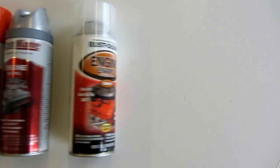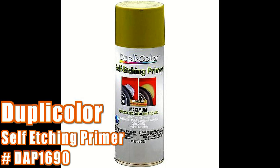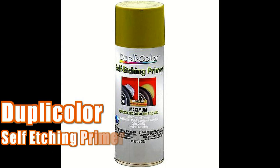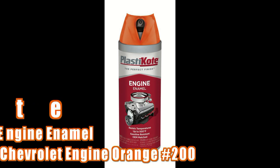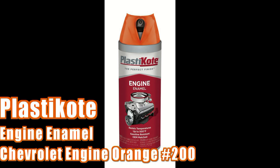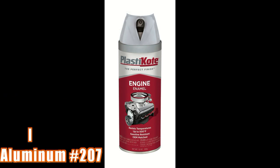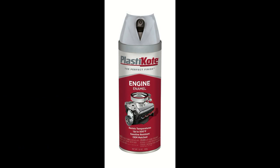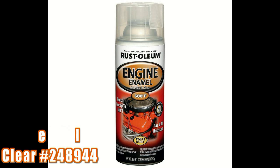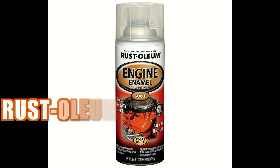Here's the lineup of paints. For the primer base coat on all plastic parts, I'm using Duplicolor self-etching primer — you can use this on both metal and plastic surfaces, and it's the best for promoting adhesion. You don't have to use the Duplicolor brand if you can't find it. For the color coat on the fan blades and trim ring, I'm using Plasticote engine enamel, Chevrolet engine orange number 200 — a ceramic resin-based paint that's very durable once cured, but has a long cure time of at least 24 hours before handling. I'll also use Plasticote's aluminum color number 207 for the fan frame. Both will be top-coated with Rust-Oleum engine enamel clear — you can use Duplicolor or Plasticote's own enamel clear instead; I just happened to have Rust-Oleum available.